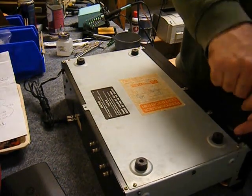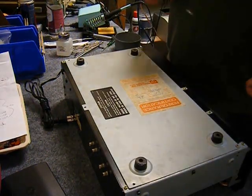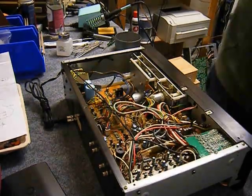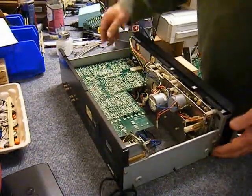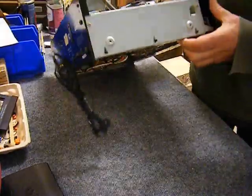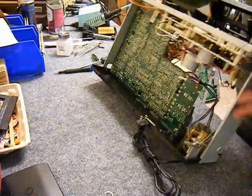The first thing you want to do is get the transport out on the bench. Take the screws out — front panel, top cover, bottom cover — all gets removed. Be careful of the little stick going to the power switch. It's made of plastic and it's 40 years old and can crack easily, so be careful of that. You twist it 90 degrees to remove it from the front panel power button. Then remove the front cover from the cassette well and the front panel from the chassis.